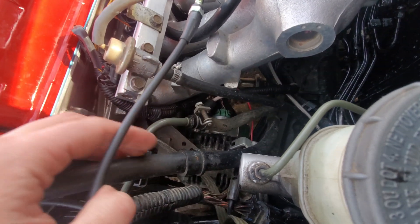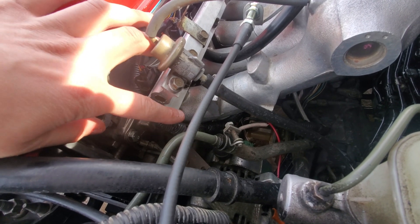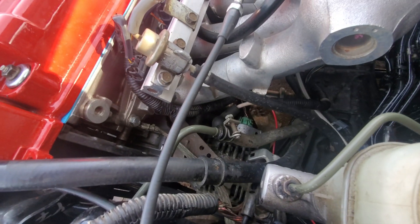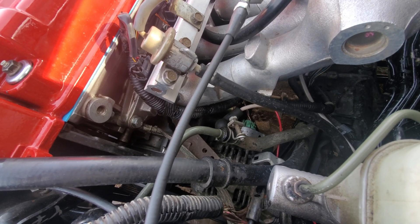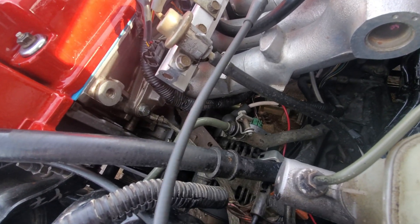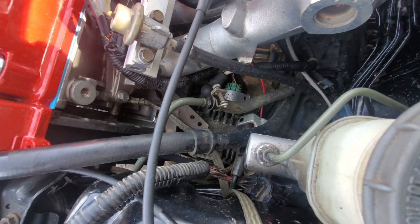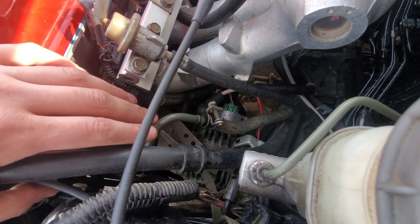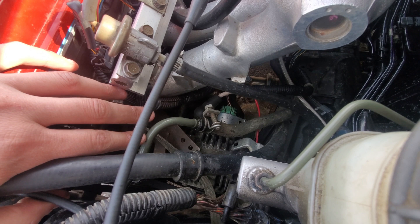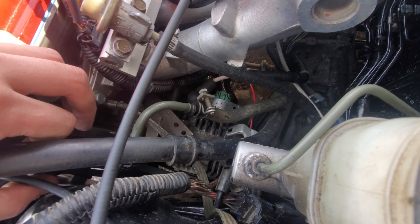The last one is the alternator — once again using CRV brackets. The only issue here is the intake manifold: the bottom bolt under the first runner, using the CRV bracket, does cover the bolt head a little bit. I just had to use an angle grinder and notch it out so I'm able to slide a bolt in just above it, and it gives you enough room — bolts right in. You need to make sure you have an OBD1 or OBD2 matching alternator. You can make a D series work; some people get away with using just one bolt — absolutely terrifying, I wouldn't recommend it. With a piece of flat bar you're able to make a spacer.